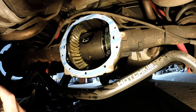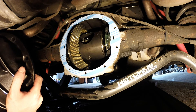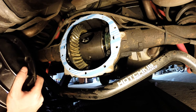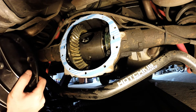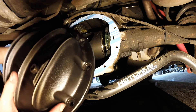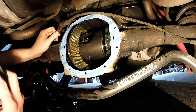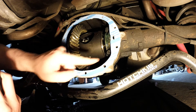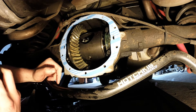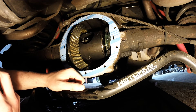Still under the car here. As you can see, the gasket maker RTV is on the axle, magically holding up the gasket. Now the next move is putting the PML cover up here — it's going to hit this brake line bracket, so this might take more than one try. PML says use Loctite on the bolts, but since the bottom three bolt holes run into the housing and could potentially leak, I'm going to put some RTV on all the bolts as I put them in.